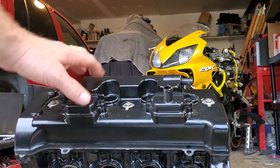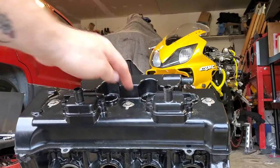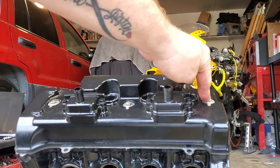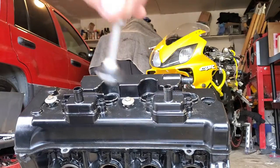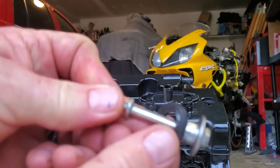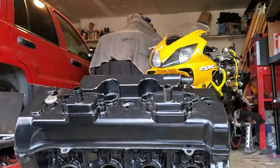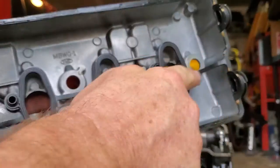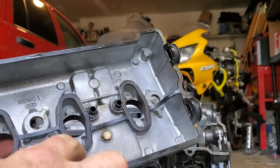This is the top of the engine — this is the valve cover. We're going to take this off. It has three 10 millimeter bolts on it. When we take it off there's a rubber gasket that goes all the way around here, so you want to be gentle and try not to break that gasket because it is not cheap to replace. I pried this piece out of there — this is a seal that seals oil from getting out of these bolts, so each one of these bolts has one. When you're ready to pull this off it should just come off like that. You can see inside is the rubber gasket — it goes all the way around. You need to take good care of that — that is an expensive gasket.